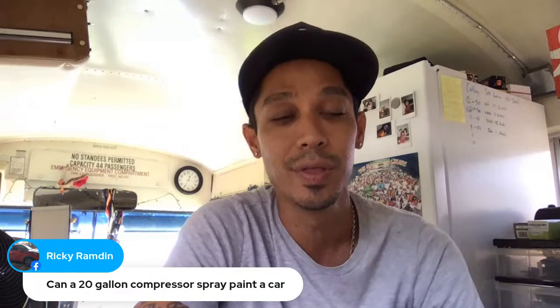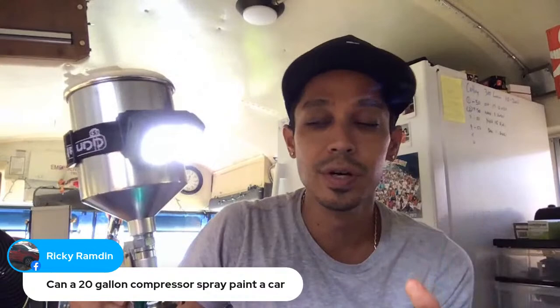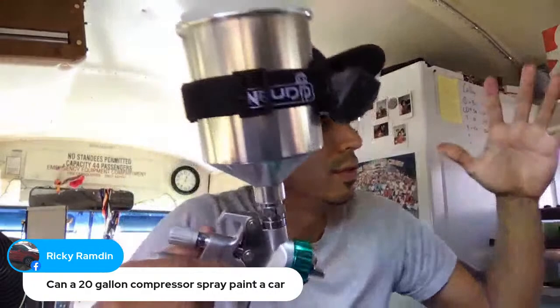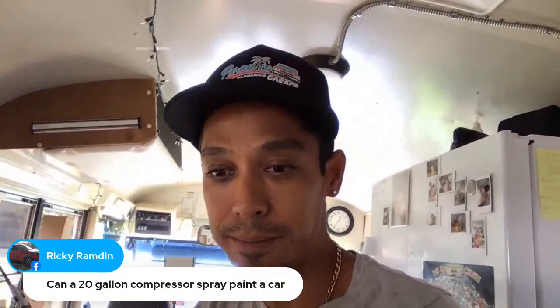Even a 33-gallon, if you're not experienced, is super tricky. You have to know how to flow your single stage or clear coat out so you don't get dry spots. That's why I like to use the Gun Bud — the number one cause of dry spots and orange peel is not being able to see how the paint is flowing on. With the Gun Bud you get direct light right on your panel as you're painting, so you can catch dry spots and make sure it's wet before you continue.